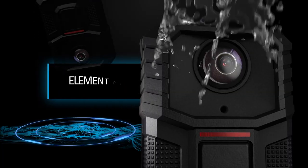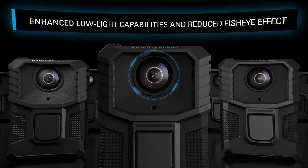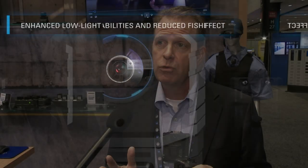Secondly, it's completely waterproof. Both the battery and the camera are waterproof rated IP67. One of the other big technical breakthroughs has to do with the imaging of the camera. It utilizes a 4K image sensor and a very wide angle field of view, and then we use a technology called over-scanning that allows us to do a number of tricks.